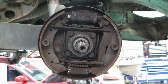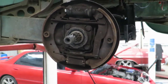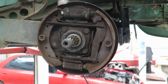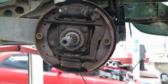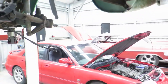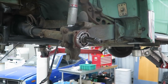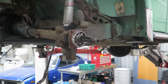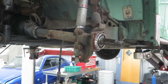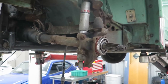That's why you really need to use a brake roller or a slip plate tester - not just drive down the road and check the brakes. Because they're not going to tell you whether one end of the car isn't working at all. You'll know if one side isn't working because it'll pull, but in this case where both rear wheels aren't working, you've probably lost 30% of your braking capacity - or maybe more because the engine's in the back - and you don't even really know it. Make sure that if you're getting brakes tested, you're getting them checked with rollers or slip plates so they can actually tell you whether something's wrong.